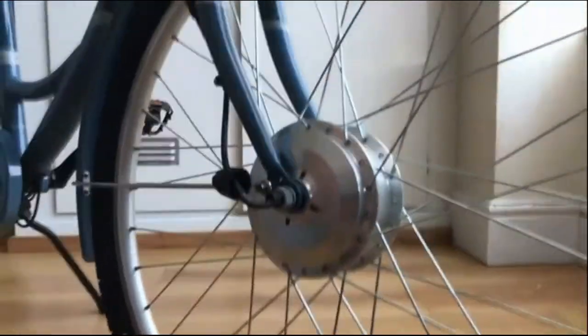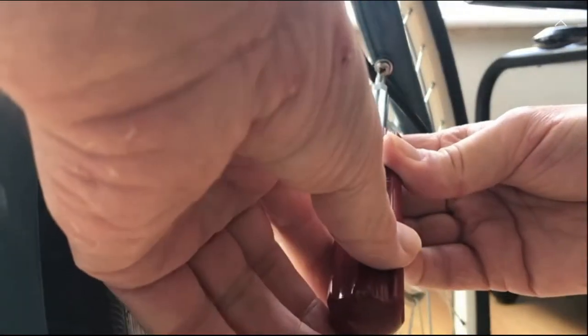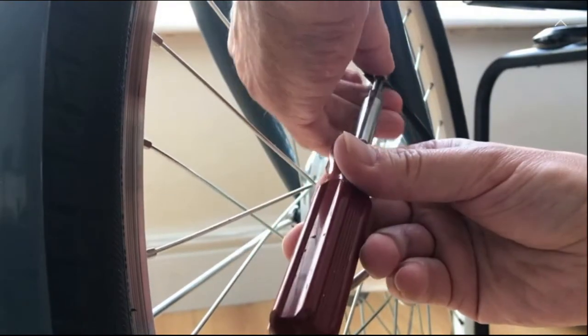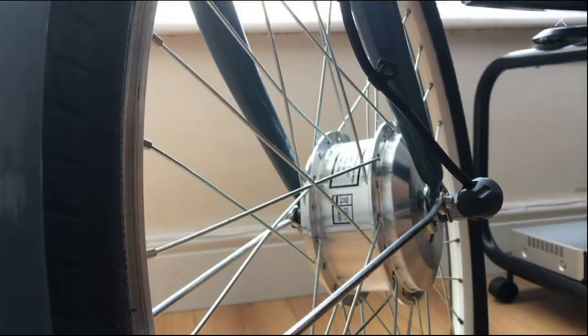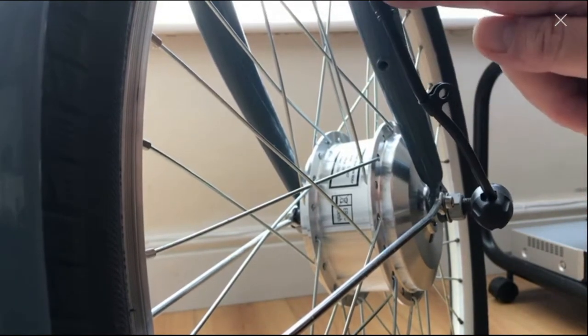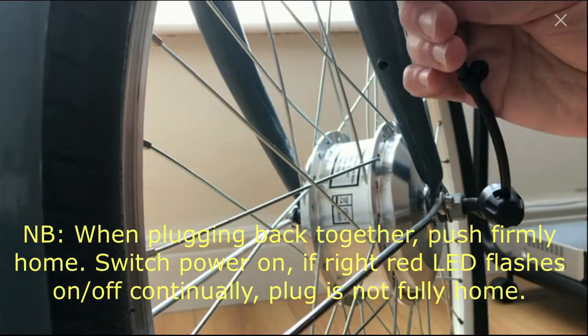There's a Phillips screw there — a proper Phillips screwdriver. There's no excuse for using the wrong kind of screwdriver; all it does is damage the screws. Now notice that's not very tight in there — there is slack on that, could have been tightened further. This is how it came from Halfords, which are very good — I've had three bikes from there. There's a washer there as well — important to note. And that's that released. So there's an arrow there in white and a black arrow there, which shows which way around that connection goes — obviously important, otherwise you'd be going backwards while trying to pedal forwards.